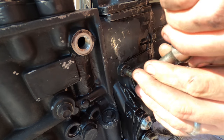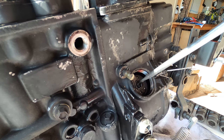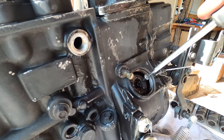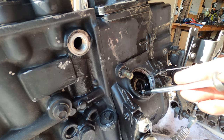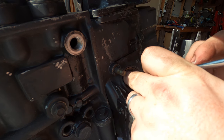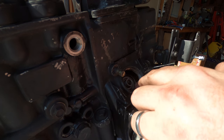The P-pump has two packs of springs inside it which you access under this cover. You have to rotate the pump so that you can see the spring packs. It's pretty straightforward to replace them but you do have to be careful not to drop anything into the pump. This retaining nut has notches on the back and is held in place by the spring tension of the governor springs. I've measured the protrusion of the stud from the end of the nut and will make sure the protrusion is the same when it goes back together. There are three inner springs to remove and replace, and one outer spring that controls the idle which I'll be leaving alone. Depending on the engine model there are shims underneath and on top — mine only has shims underneath to remove. There's also a spring land at the bottom that has to come out and is replaced by the one that's part of the governor spring kit.